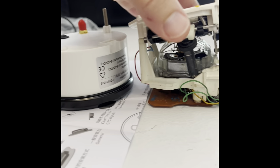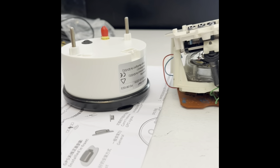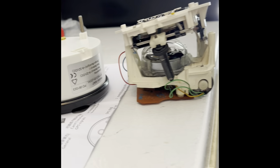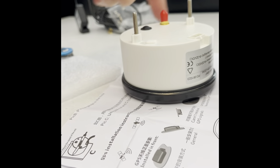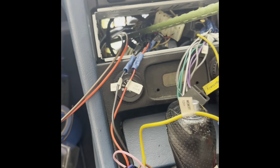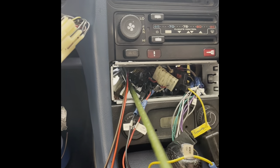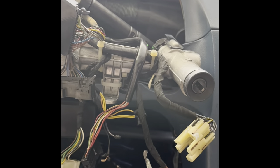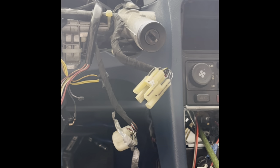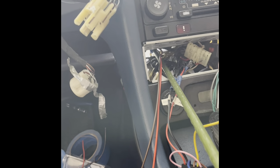I think that's originally why I bought the spare part — I snapped it and swapped pieces to preserve the mileage. I still have the odometer circuit board. For the wiring, there are three wires: one for normally-closed which I won't use, red for ignition/intermittent power, yellow for constant power, and Porsche brown for ground.